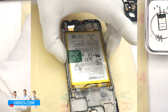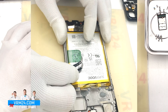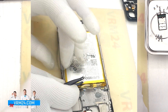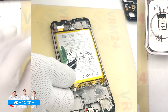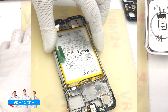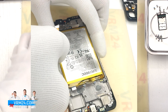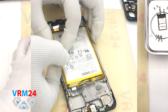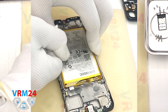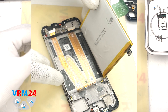Finally, we move on to detaching the battery. We have one white-green colored pull tab that needs to be unfolded and a transparent protective cover that needs to be turned aside. We pull off the transparent cover and carefully pull the green tab upwards, thus removing the battery. Under the battery we have a transparent protective covering that protects the interboard cables.